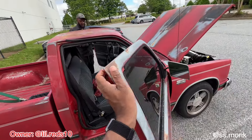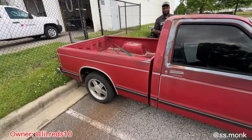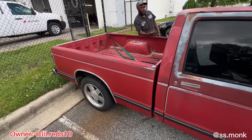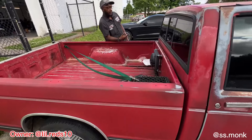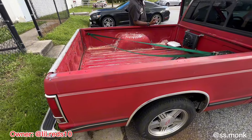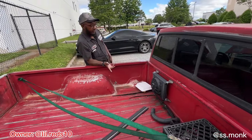It took about a year to do it, just doing it on weekends here and there, with the little hiccups I had. I ended up putting in a cam, and used the springs that came with the cam, kicked it off, and bent a valve. So I ended up doing a valve job and everything when I redid the heads.